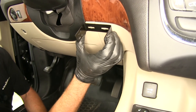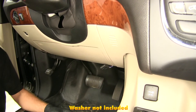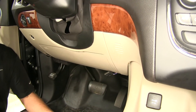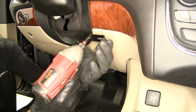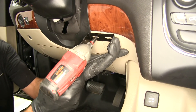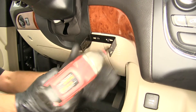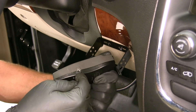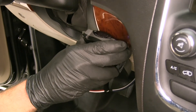Now we're going to be mounting our bracket right here. There's a little bit of wiggle space, so what we're going to do is place a small washer right in behind it. We want to use the provided self-tapping screws and we can use a quarter-inch bit driver. We'll just get those started, and that will give us a good solid mounting location. Now we'll just fit our brake controller into the bracket — we can see the holes on each side and we just want to line those up with whatever holes we choose in the bracket.